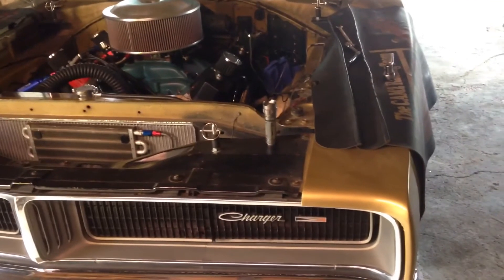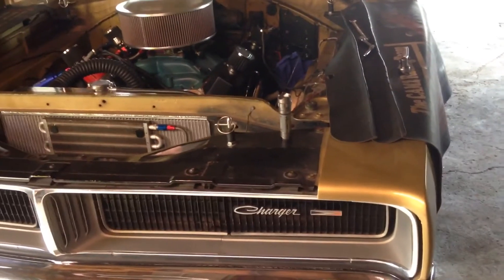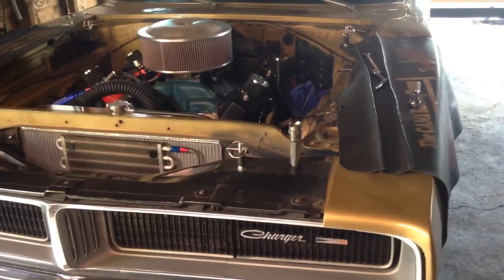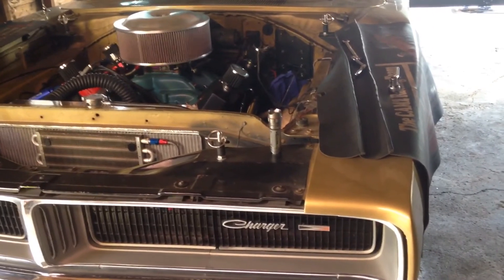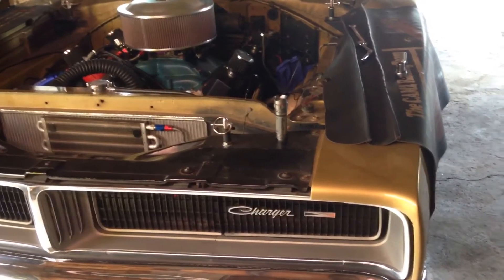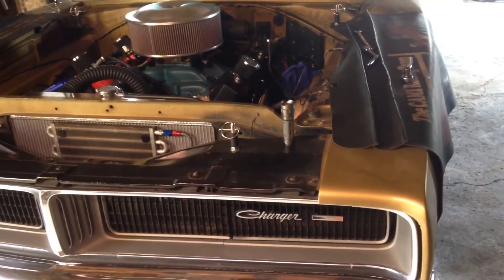If you have symptoms like a really hard pedal but it doesn't feel like you can stop — that's because you have too big of a bore in the master cylinder. You need a 15/16-inch bore. Dr. Diff sells those; it creates better line pressure. I stripped this out the other day, measured it, and I definitely had the wrong one.